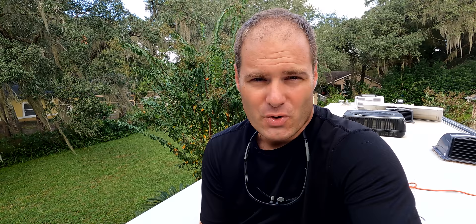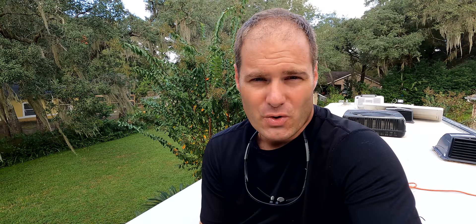Charity brought me a coffee, so I am ready to continue on. Now that we have the Flex Seal off, I'm ready to go ahead and peel up all the old lap sealant that I put on a couple of years back. What I'm going to use are these plastic putty knives. You don't want to use metal because it could cut into the membrane of the roof. I'll use these and go ahead and start peeling off the old stuff so we can clean it up and put on the new lap sealant.